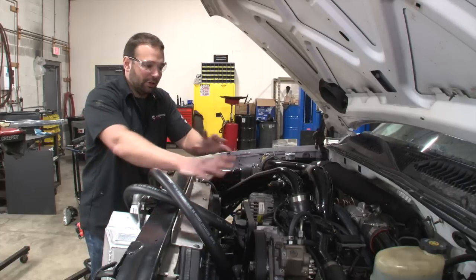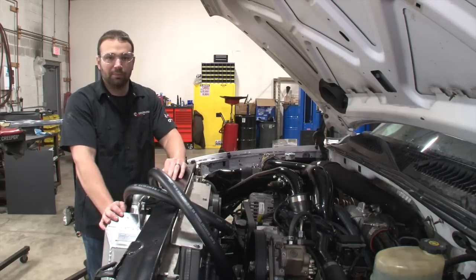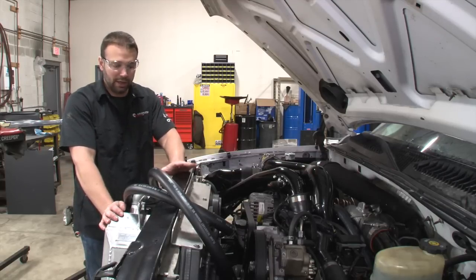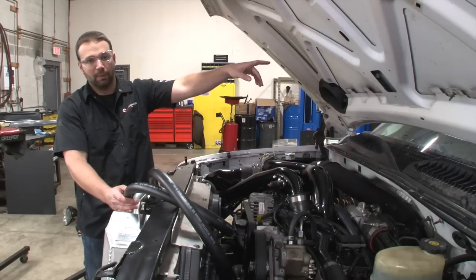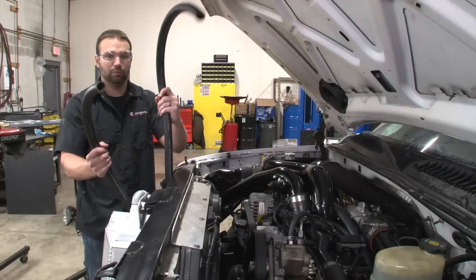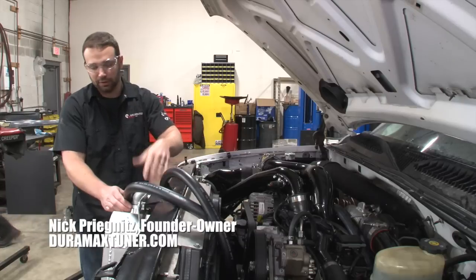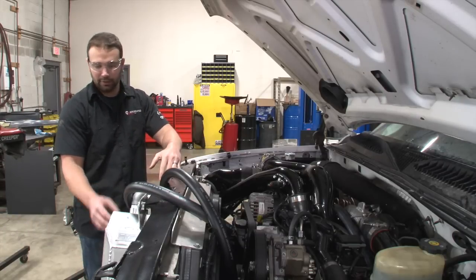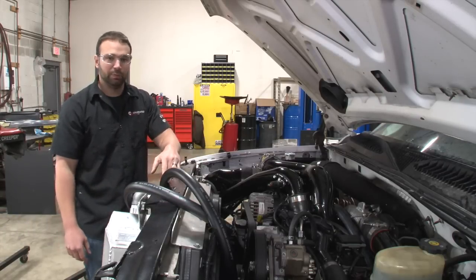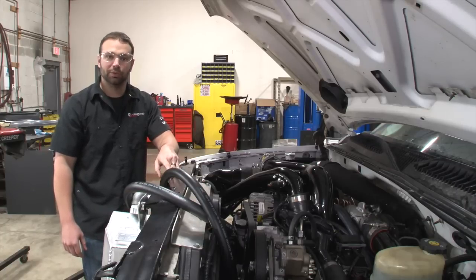We got all our data logger stuff set up and the guys are just plumbing that air to water system. So the water lines are something we have to do here. We got the water lines one run from the tank back there. Up here you can see we got two big one inch feeds. Or actually, these are the returns, and then the feeds come in from the bottom, and that water works its way up the tank here. This system should be a lot better at controlling EGTs than our previous system. At least I frickin' hope so. It's been a lot of work.